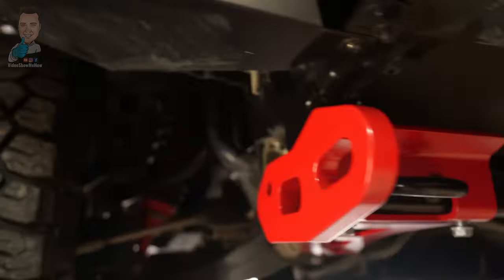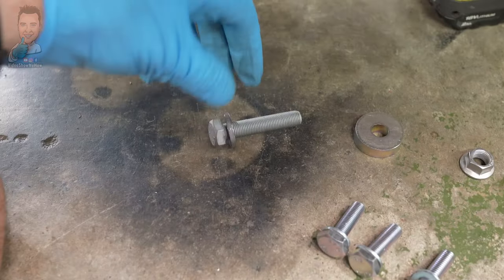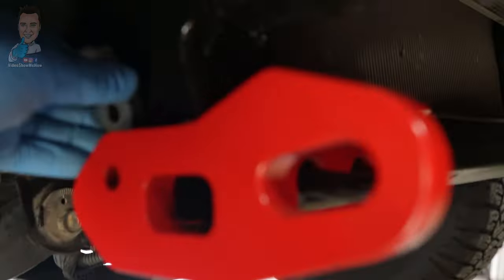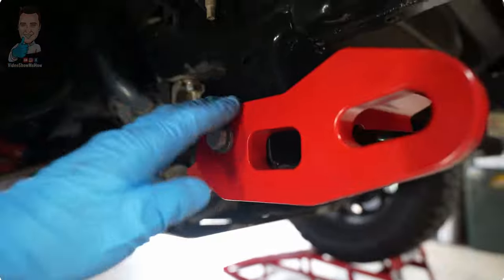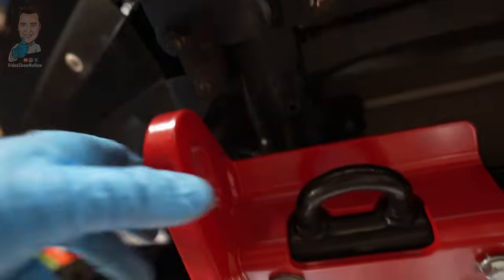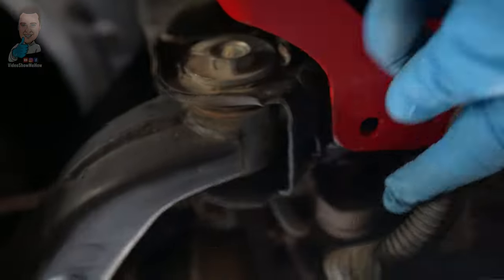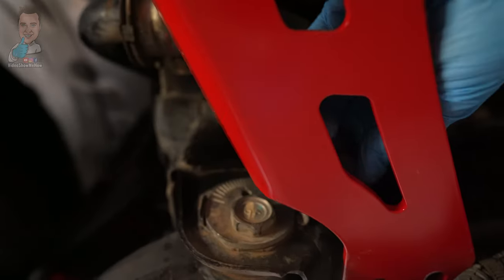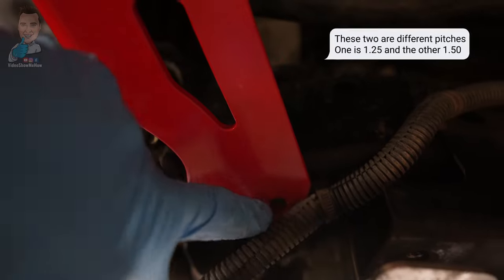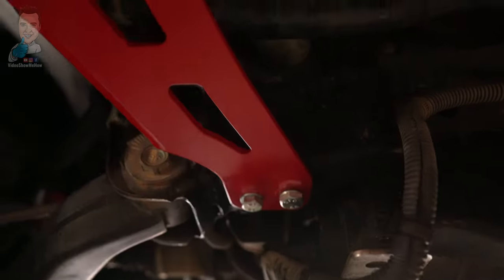This front bolt is a big 60mm one — it goes through there, and on the inside there is a spacer that needs to sit between the chassis rail and the recovery point itself. It's a little bit finicky to get in with that washer but just take your time and you'll get it in fine. Working our way to the back you'll see a couple of holes underneath — our little tail nut goes through the first hole and the other is the factory position. Wiggle the tail around to get everything aligned and tighten those down.